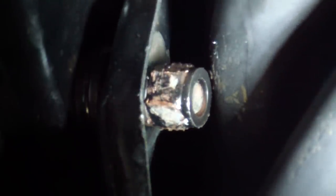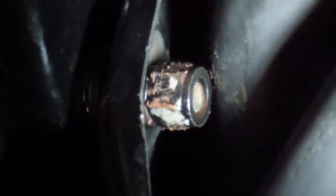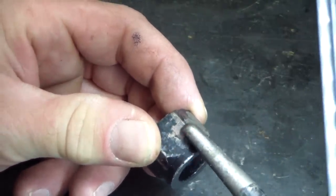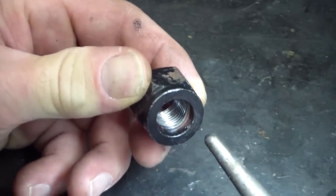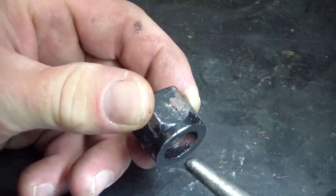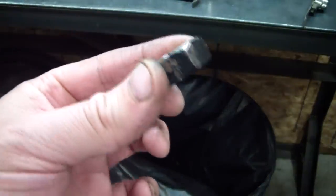We've got another Hooker header issue here that shows, in my judgment, poor engineering. Whoever had the car as their demonstration model probably had it set up with the nut further out. But if you ever had to have it adjusted, the nut's going to be binding right into the pipe. To alleviate the situation, we're going to machine all this off from here down — there's no thread even on here anyway. We're going to eliminate that one eighth and then go another eighth to about here, then we'll miss the pipe. Here's a look at the nut after it's been faced down some. As you can see now, the lower control arm bolt can have full travel and it doesn't make contact with the header tube.